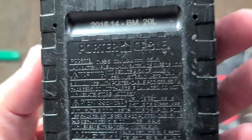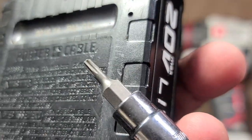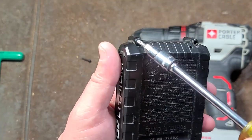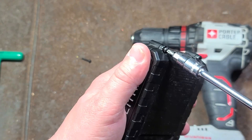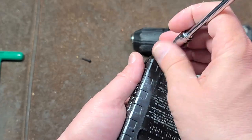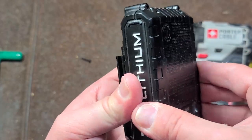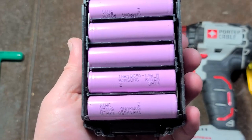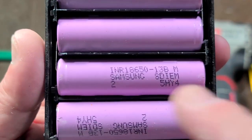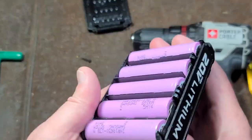This battery pack says it is 25 watt hours — that's insanely low capacity. A 20 volt max battery that's only 25 watt hours means it is a 1.25 amp hour battery — one and a quarter amp hour battery. That is about as low a capacity as you can possibly get. It is using Samsung 18650 cells, and I suspect this '13B' means 1.3 amp hours. Not good.